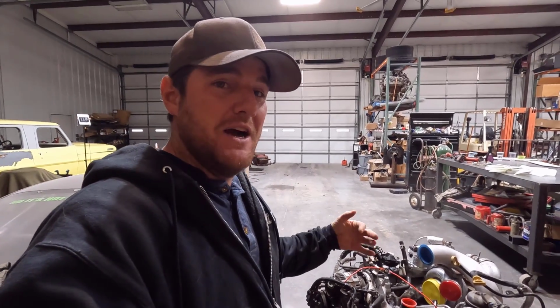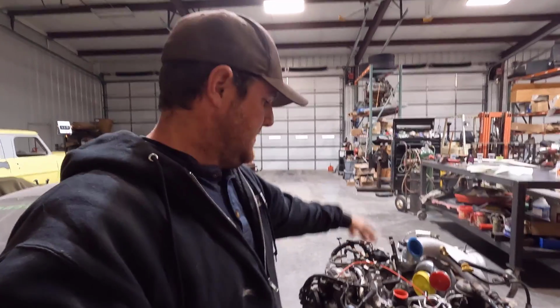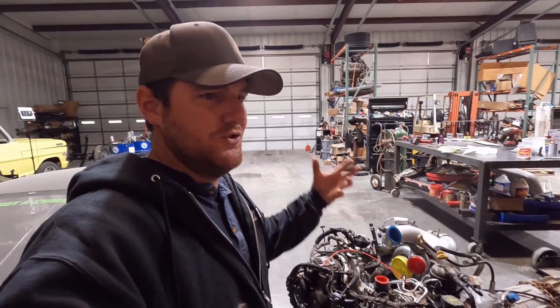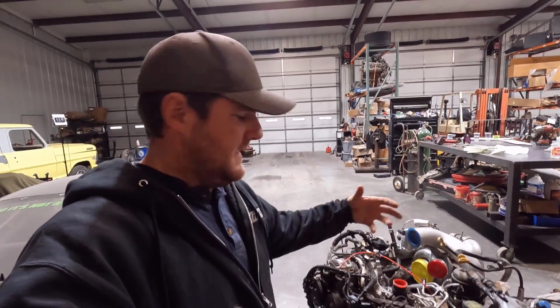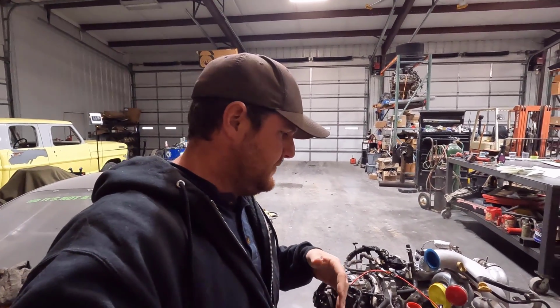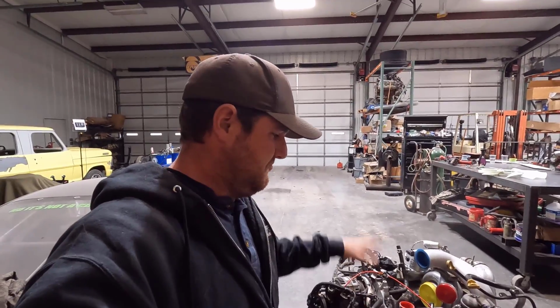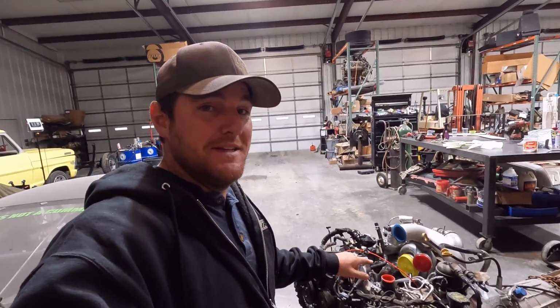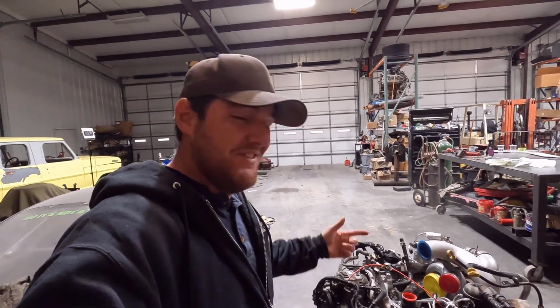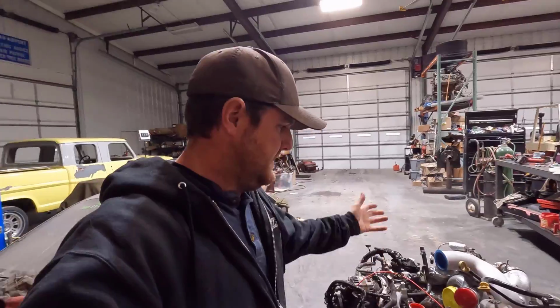Looking back now, I should have got their DCR pump, which changes out the whole injection pump completely, changes out the CP4 that's prone to failure to a more robust pump that they made work in here. I've actually installed that on my black dually truck you might have seen in the channel, where I take on buys and stuff, and it was a great kit. It just bolted right in, and I would have put this on this thing, but I already had the disaster kit bought, so they didn't have that released when I was buying parts for this thing. But we'll see how it goes.